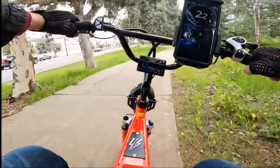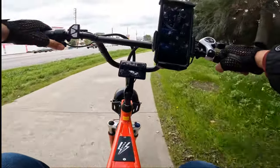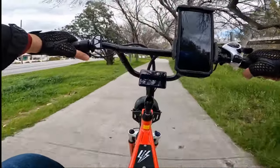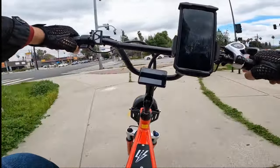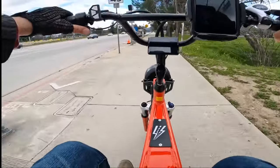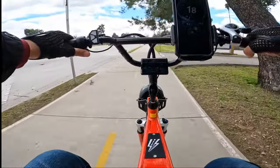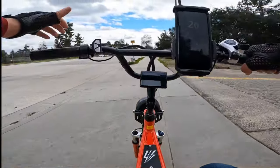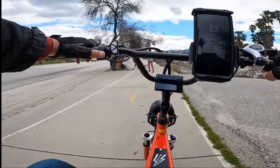If you're planning to ride uphill it will be really tough. This bicycle is mostly designed for beach riding on flat surfaces — not for off-road. I would not recommend anyone buy this for off-road because it's a hard tail. I also put high PSI high pressure in the tires, which makes it a little harder to ride but gives you better performance on pavement. If you want a smoother, more comfortable ride, consider putting around 40 PSI in the tires.